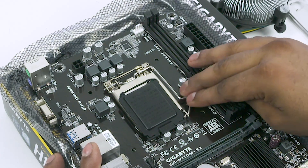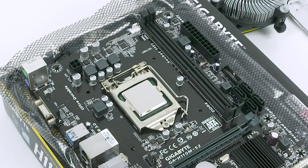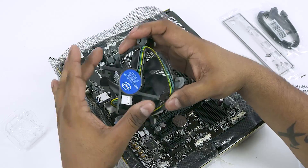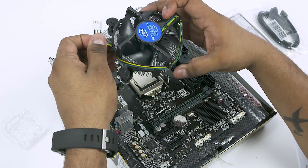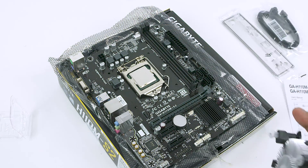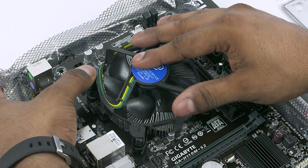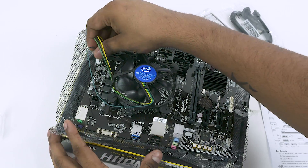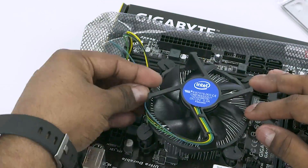The plastic on top will come off and that is to be expected. Next, the CPU stock cooler — the thermal compound is pre-applied here, so you don't have to deal with that. Intel's stock heatsink has push pins to attach to the motherboard, so place the cooler so that you have the shortest amount of free cable to the fan header. Just press the pins, you'll hear a click — do it in a cross pattern. Once you hear the click, you're good to go. Plug the white connector into the CPU fan header on the board, tidy up the cable, and we're good.